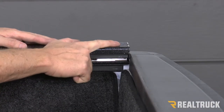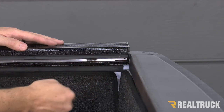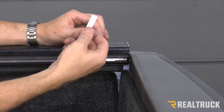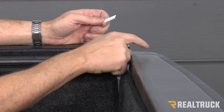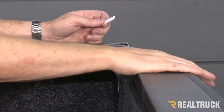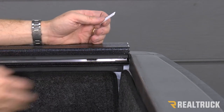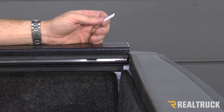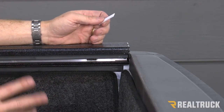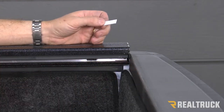One thing we have to do is make sure this rail is 1/16th of an inch away from the tailgate when the tailgate closes. I took a 1/16th inch spacer shim — you've got some white ones in your kit. I cut one of those in half, stuck it to the end of the tailgate on either side, and closed the tailgate up against the rail, forcing the rail forward. That way, once I lock down my clamps, I can drop my tailgate, remove my spacer shims, and I've got the 1/16th inch gap. I'm only doing that because I have a bed rug with a little bit of thickness that has to be compressed at the front. If you don't have a bed rug, just make sure you have a 1/16th inch gap.